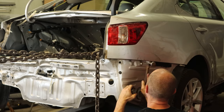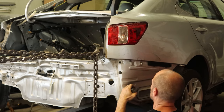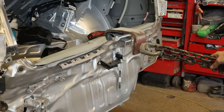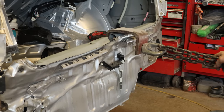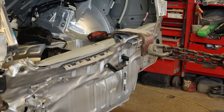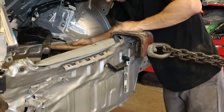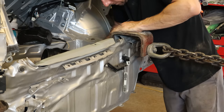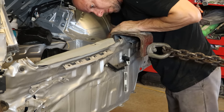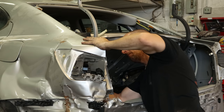Take our time and hopefully we'll make our bodywork gnome's life a little bit easier. Is it okay that I'm using a body hammer on the body? If it's not, I'm going to do it anyway. So now we've got a big clamp — it's not really a clamp, it's more like a hook. We're just going to pull out our body panel, hammer it flat so that we can cut it off later. As we do this, we're also pulling our quarter out a little bit and anything that's attached to our body panel.